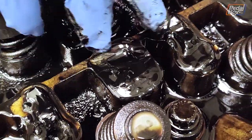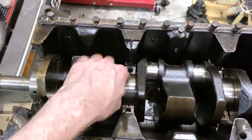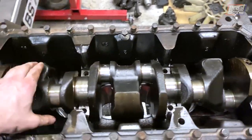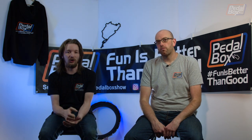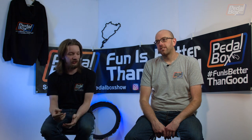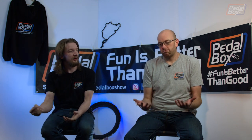The good news is I've found that if I grind the crank down by about 2 mil, it turns out there's a chap in our comments, a guy called Simon by Turbo, so cheers to you. Thanks, Simon. Found that Nissan's L28E, the engine that went into the 280Z, the 2.8 straight six, actually has a very, very similar shape and size conrod. That's very convenient to my engine. So there's a couple of little bits and pieces I need to do, like I'll need to rebush the piston or something like that and grind the crank down a bit. But the crank's getting reground anyway, so might as well.